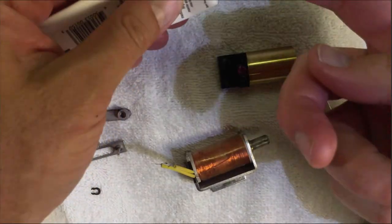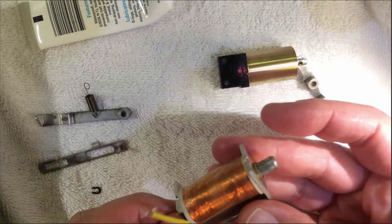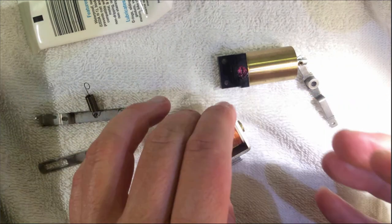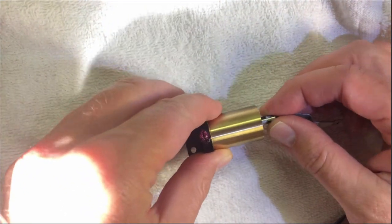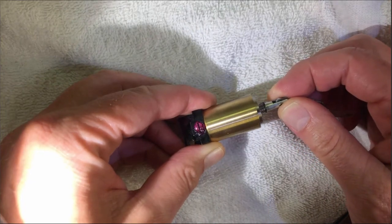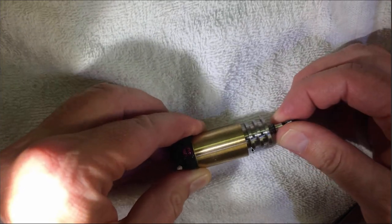First the solenoid — just a little bit of silicone grease on that plunger, then move it in and out a little bit to distribute the silicone grease. The plunger of the damper is slightly more challenging because it has a pretty tight fit on the inside and it's easy to get it stuck if you pull it off-center. It's good to open this valve here a little bit so air can get in while you pull it out. Very carefully try to pull it out straight without getting it off-center — if you tilt it, it can get stuck and be difficult to get moving again.